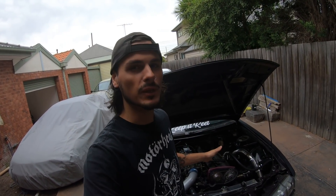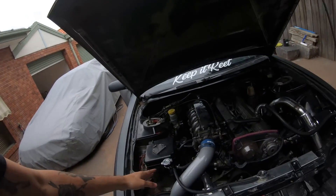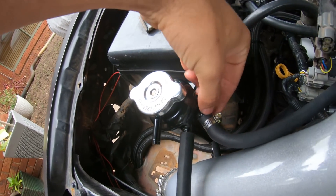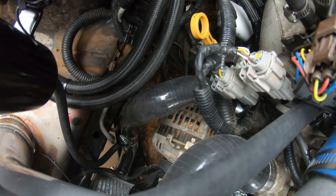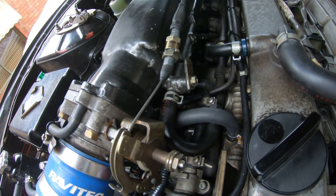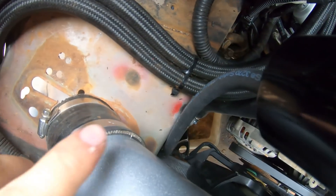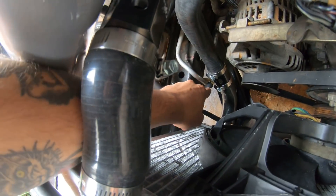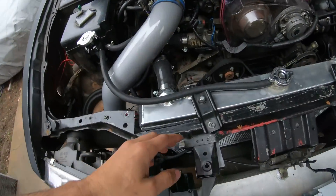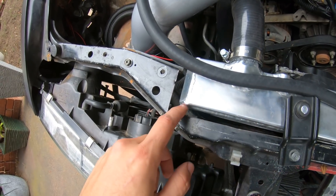The next day — I did skip a lot of filming on how to do all of this because the neighbors' kids were screaming and bouncing on the trampoline while I'm trying to work on the car. So let me show you guys exactly what I've done and how to set up this swirl pot. The fitting — third one from the top — I've got this Gates line with no kink in it. It runs underneath the intake manifold, up through around, and over into this port down here. There's no kink in that — it's perfect, so it won't be blocked when the coolant's flowing through. And then the one at the bottom, the line runs all the way to the bottom radiator hose down here to the fitting. The job isn't hard to do, it's just trial and error trying to make everything fit. I like how this is nice and clean here, but I accidentally cut off too much — but who cares? It's a track car.